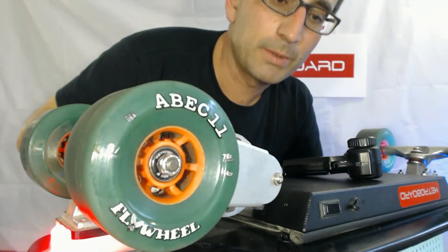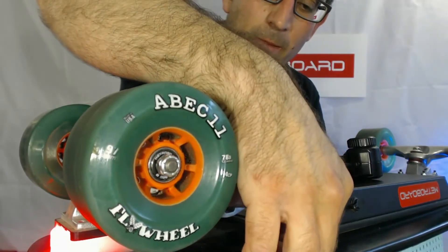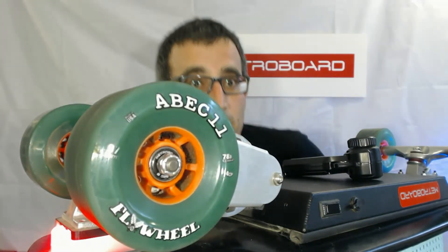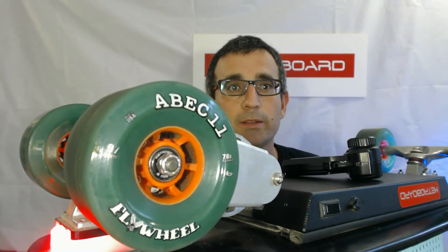Once you get in that position, to complete the binding process you have to pull out the bind plug. Leaving everything on the way it is after you've just paired it, go ahead and pull out the bind plug. That will set the fail safe — so exactly at that moment where you pulled out the bind plug, that's what it's going to do when you lose connection with the remote.